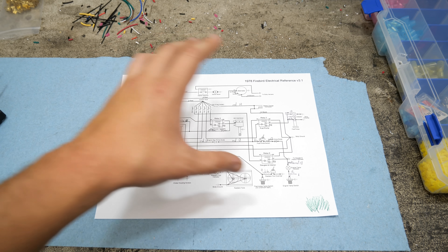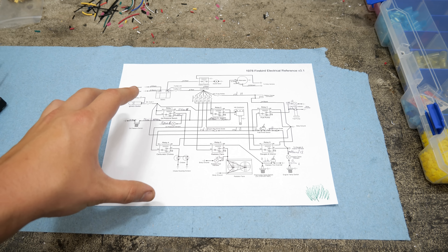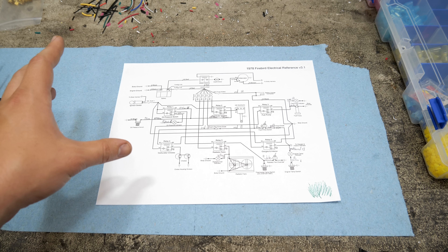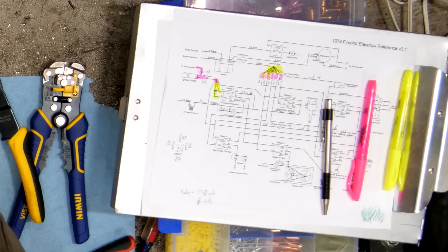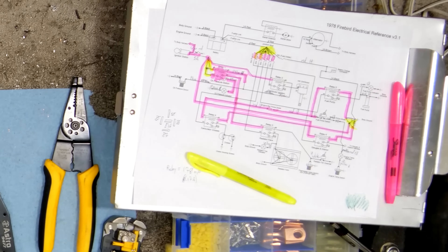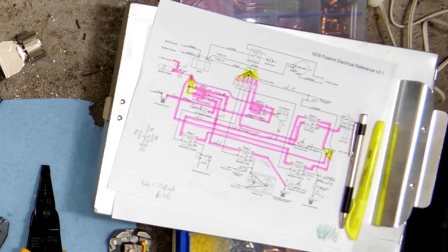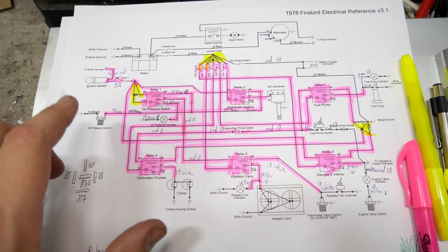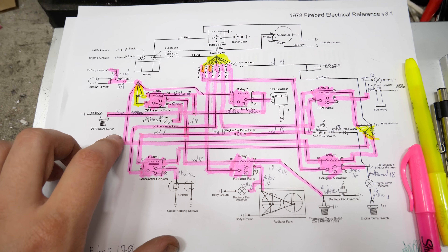I should also point out that this is really just the relay box diagram — there's a lot that's not on here, including the senders for the gauges and really anything in the interior. I used the yellow highlighter to note changes in the drawing because of how I had the junctions in my head versus how the junctions came together in reality. And I used the pink to mark out circuits as I went, which was a big help. I feel like it was really worth the time to do this whole diagram compared to other times when it's either in my head or just roughly sketched on paper. It was kind of cool to do it straight off the diagram and use it as a guide.